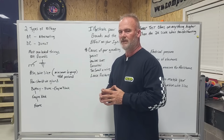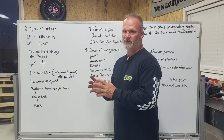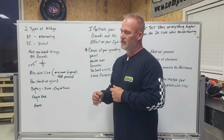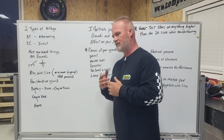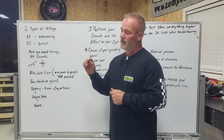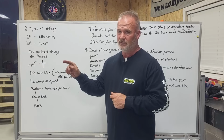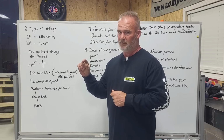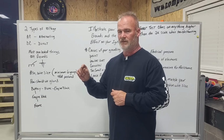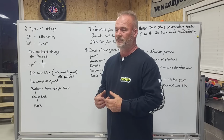Let's consider that to be low voltage, high amperage. That volume of water is your volume of electrons, and it's a lot of them, but there's not much pressure behind it. Now let's take the same hose, everything the same, except I put a sprayer on it, and now I have a little tiny 1/8-inch stream shooting 30 feet. I have not much volume of water, but I have high pressure. That is voltage. And the ohms is your resistance to that flow.